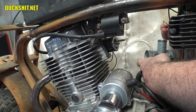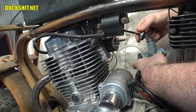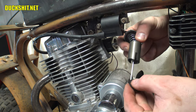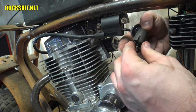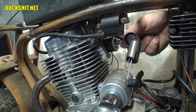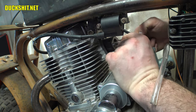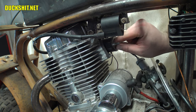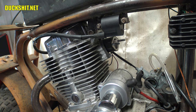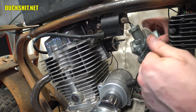Alright, put our slide back into the top here. Oh, damn it — there's a little gasket here that came off that I forgot to put back on first. This belongs way up in the crown; it doesn't belong this far down the slide. Let's see if I can get it up there without ruining it. Yep, it made it — all the way up in the top.